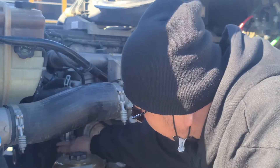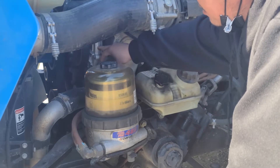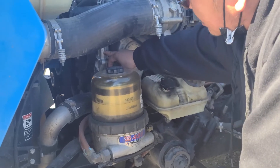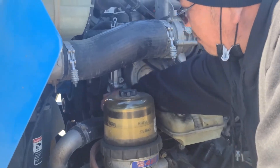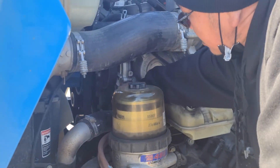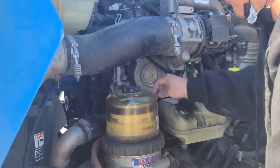Now from here, I'll move to my water pump. This is my water pump — it's not cracked, not broken, not damaged, it's securely mounted, no missing hardware, and it's not leaking. It's also belt driven. The belt itself is not frayed, worn, or cut. It's securely mounted, and when I pull at the center point, it has no more than three-quarter of an inch of play.